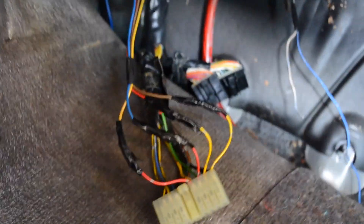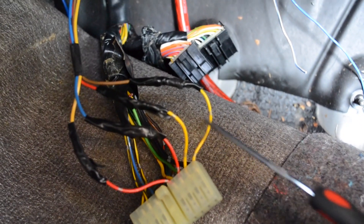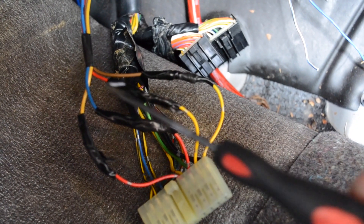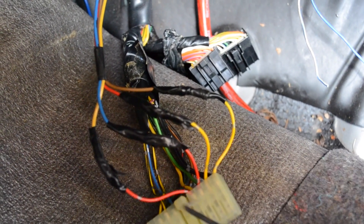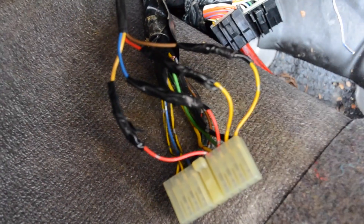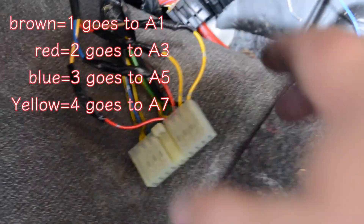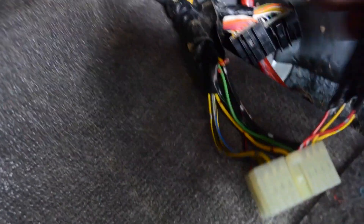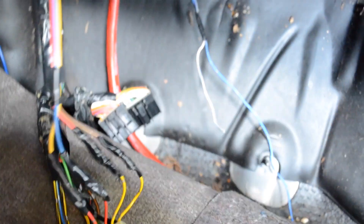The injector wiring is finished. Number one — yellow wire coming out — goes up to the brown wire. Number two, even though it's yellow, goes to the red wire. Number three has a red wire going to the blue. Number four has a red wire going to the yellow. So: brown one, red two, blue three, yellow four. That's what it looks like — four wires coming out into my separate injector harness. We now have four injectors wired up.